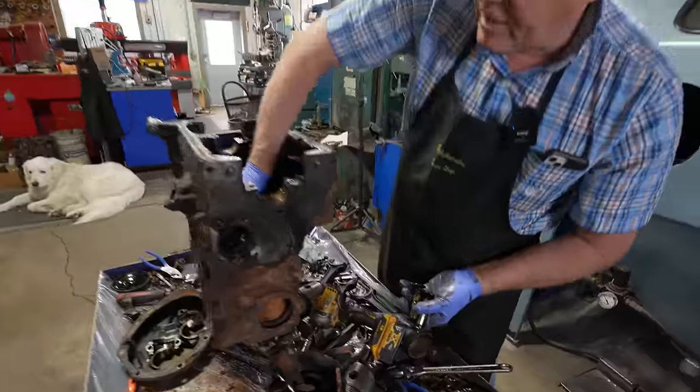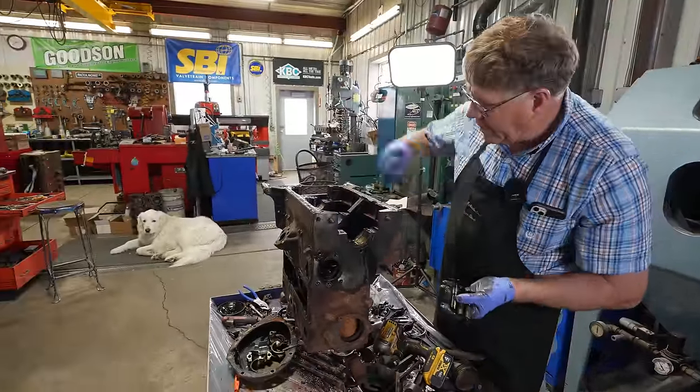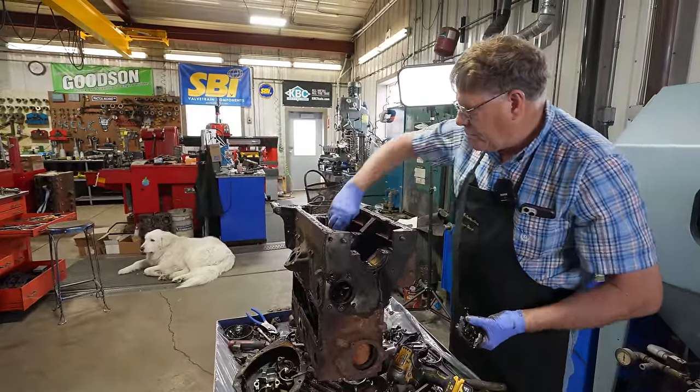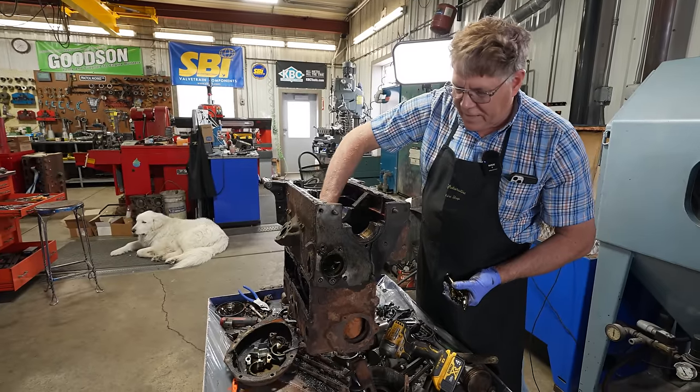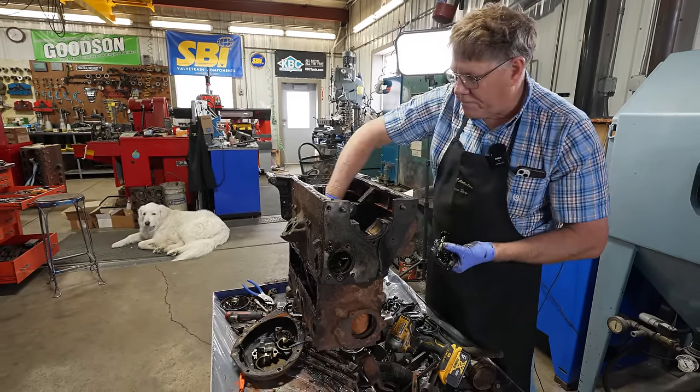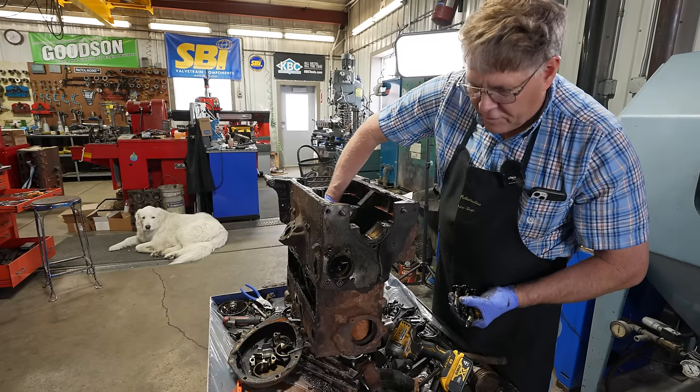These engines use one cam bearing in the front. All the other positions — three other positions — they only have four bearings on them, and those are just metal to metal, no bearings installed. So we'll knock that out of there. Since we're going to have to do something with that cam, I'm not even going to try to keep the lifters in order — we'll send them in and get them refaced. I think our buddies out there at Delta Cam should take care of that for us. Cupped out, wearing away. Be interesting to know how many miles or hours this engine really has on it — probably lots and lots of short trips, start and stop, with oil changes far and few in between.